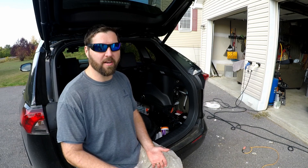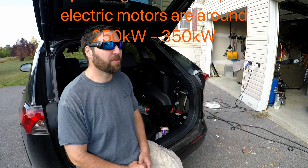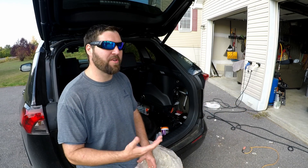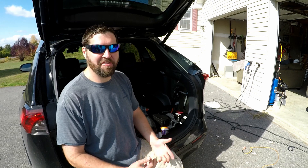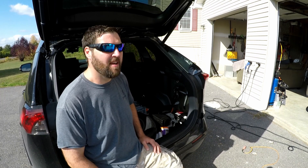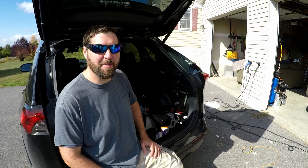Think about it — if you floor your car, how much power is coming out of your battery pack? That is going to be way more power than it takes to power your house. We're talking 40 amps to power the house at 10 kilowatts. EVs see 250 amps just like that — so you're not going to damage anything. It wouldn't hurt the car or the house. But ideally we would do this someday with a whole-house off-grid inverter. Part of the reason I'm doing this today is just tinkering and testing — I wanted to see what the DC-to-DC converter could really put out. I've got my meter so I can do current testing, and once we know that current measurement and the battery pack voltage, we can do a simple calculation and figure out how many kilowatts are coming out.